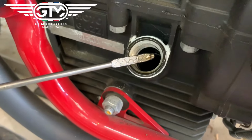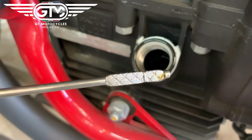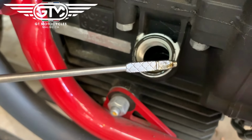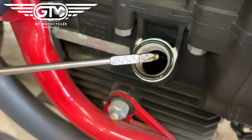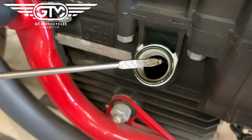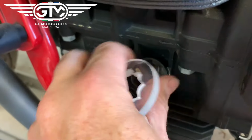as opposed to what the factory tells you to fill, two quarts. If you see that first mark above the bottom of the stick, we consider that full. I'm not sure if you can tell or not, but that's right where ours is set to that mark. If you go any higher, it'll just pump the oil into the airbox, and then you'll have a whole other set of problems. So anyway, that's kind of it, and we'll just put it back on for you.